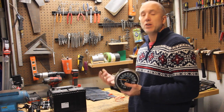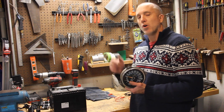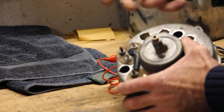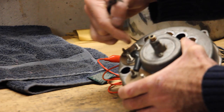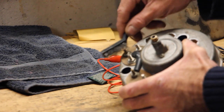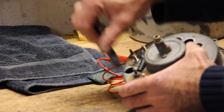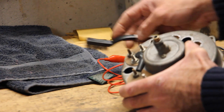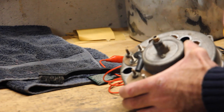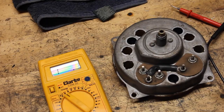If your speedometer is still in your vehicle and you're trying to figure out what the problem is, we'll also go through that later on in this episode. Before we get started testing, make sure that your posts — all five of these — are fairly clean. I'm going to take a wire brush and get rid of the corrosion and a little bit of surface rusting, because the last thing you want is something inhibiting an accurate reading when you use your voltmeter.